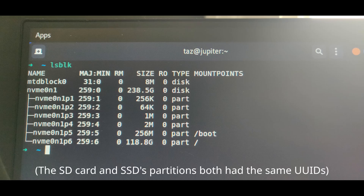So for the time being I gave up and just used the SD card. As a last resort, I decided to clone the contents of my SD card to the NVMe drive, and I managed to trick the system into using the NVMe's boot filesystem and root filesystem. This was definitely an improvement over using the SD card on its own, but it's still a suboptimal solution.